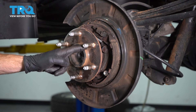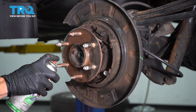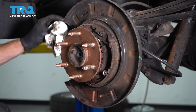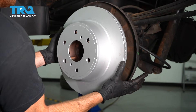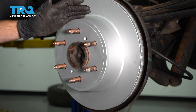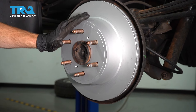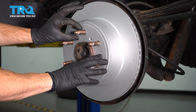Now let's move along to some copper never-seize on the mating surface of our axle where that brand new rotor is going to sit. Once you've done that, make sure you didn't get any on your emergency brake shoes. Now we can go ahead and put on our brand new rotor — slide it right on over all those lug studs and press it in. Our rotors come with a special protectant on them that you do not need to clean off. Slide it on and then use a lug nut to hold it in position.